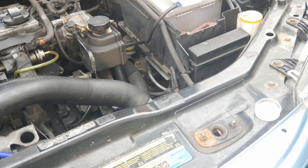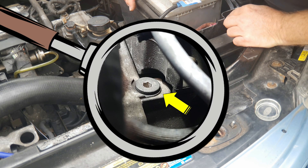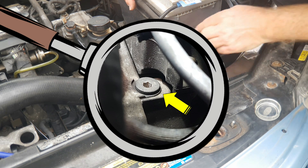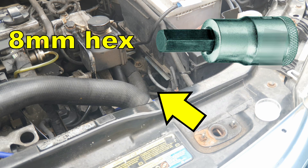One of the defining features of this gearbox is that it does not have a side-mounted fill and level plug — the fill plug is on the top of the gearbox. You can actually see it in this shot; I've got a socket located in it, and you will need an 8mm hex to undo it.